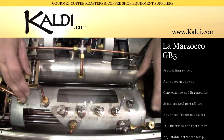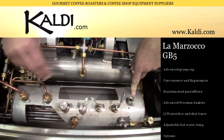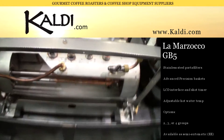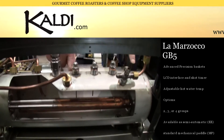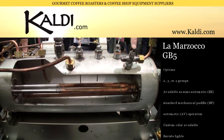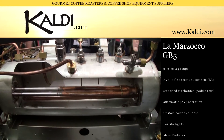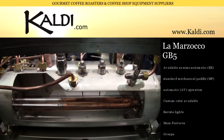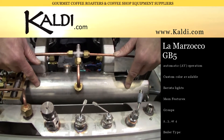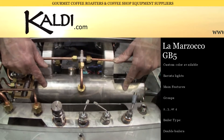In the GB5, in addition to a heating element to heat the water, there is a heat exchanger. So the water flows through the pump, from the pump into the heat exchanger, is heated, passes through a water mix valve, and goes into the coffee boiler at 160 to 170 degrees. By doing so, it guarantees better temperature stability for brewing your shots.